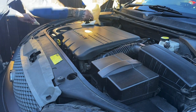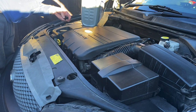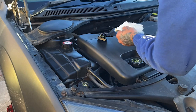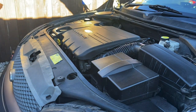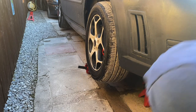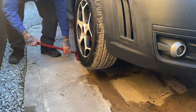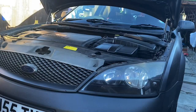So again, with the funnel, I topped it up with some more fresh engine oil. A quick check on the dipstick again — perfect. So I removed the funnel, refitted the oil filler cap. I then quickly jacked up the car again, pushed under the axle stand, and checked for any leaks on the oil filter and sump bung — all good. Then I removed the axle stand, let the jack down, and finally shut the bonnet.